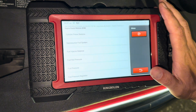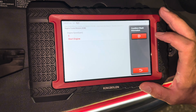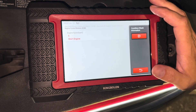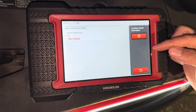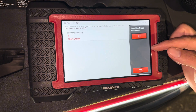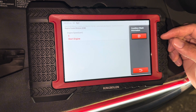What this test does is it allows you to pulse each cylinder's fuel injector with extra fuel so you can see the variation of pressure as you're doing it. So if you have faulty injectors or suspect faulty injectors, you can run this test — if you activate one and it doesn't do anything, you know that one's faulty. Once you replace your injectors, you can also do this test to validate that the job has been done correctly.